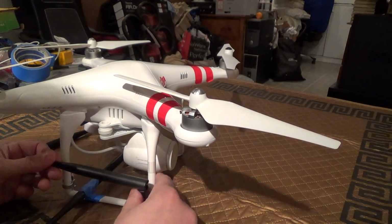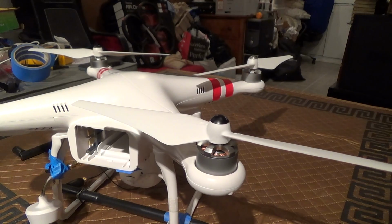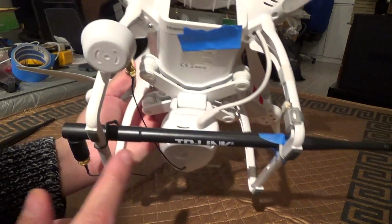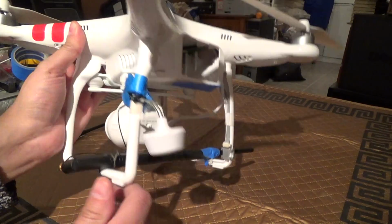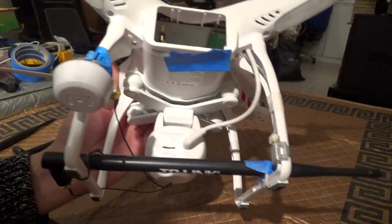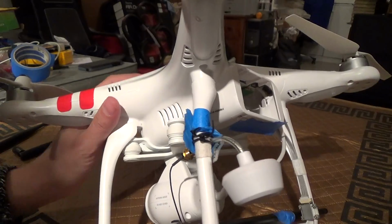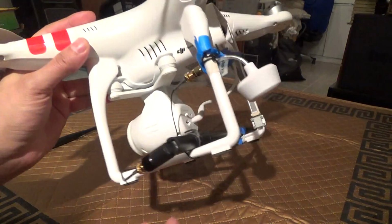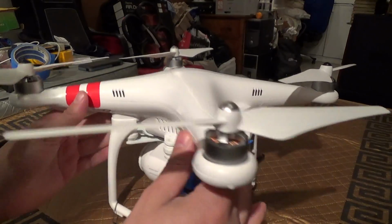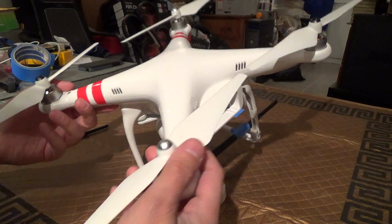Moving over, same antennas, one like this and one that way, gave pretty respectable results. And so far my favorite configuration has been with a helical antenna, and this particular one is my 8 dBi TP-Link. This is a 5.8 gigahertz cloverleaf design. A 2.4 gigahertz would be a little bit larger, provide better gain, and work better. The reason for that is so that we have better reception, especially closer range, while you're rotating in all directions, whereas the Omnis can have a little bit more difficulty when you're often just moving around in general.